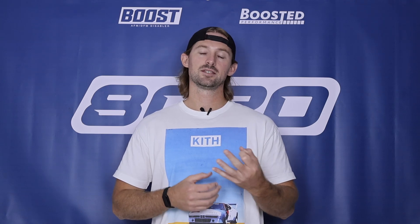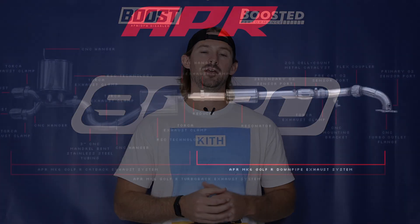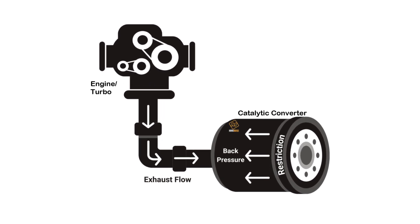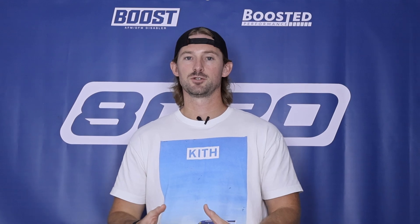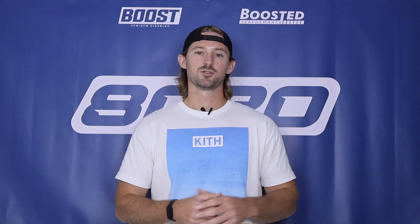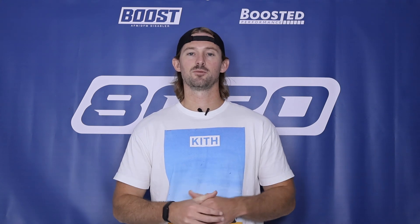An intake is an essential modification to make sure we're giving the turbocharger what it needs to create higher boost levels. That brings us to our third modification: the exhaust system. Now that we're running higher boost levels and bringing more air to the turbocharger, we need to help that air get out of the engine as well, and we're going to do that through an upgraded downpipe. The downpipe is the most important part of the exhaust system since it bolts right up to the turbocharger and houses the catalytic converter — that's where the majority of back pressure gets created. That back pressure builds up between the catalytic converter and the turbocharger, acting as a negative force against the turbine wheel. It slows down your turbo spool, puts more stress on the turbocharger, and makes it harder to do its job. By upgrading to either a high-flow catted downpipe or a completely catless downpipe, we can reduce all of that exhaust back pressure, which frees up turbo spool, improves turbo efficiency, and helps reduce the heat the turbocharger produces — which is great from a reliability standpoint.